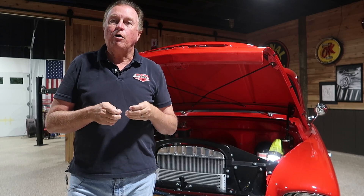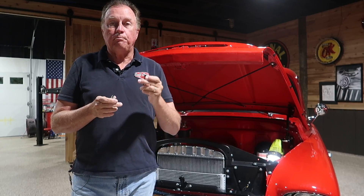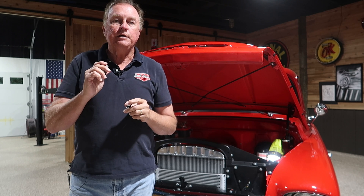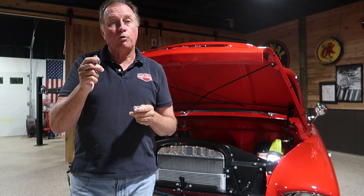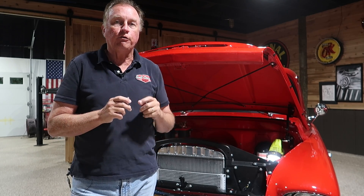What I have right now is what I believe to be a 2 gallon per minute flow valve with an adapter to get it to a minus 6. What I wanted was the biggest valve I could get. This one is actually an SF-23, and they claim it is a 4.5 gallon per minute flow valve, which is what I think I'm going to need on this close-ratio power steering rack off of a C4 Corvette with a Z51 package.